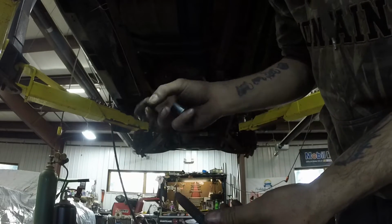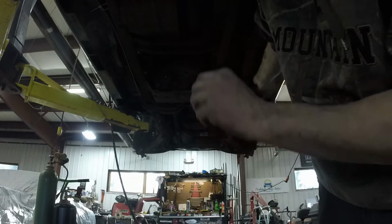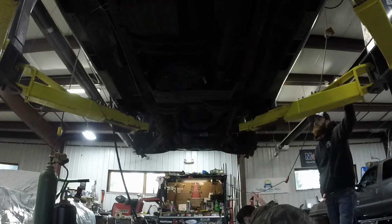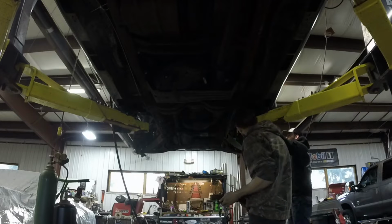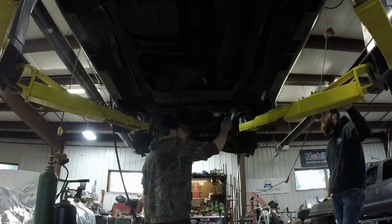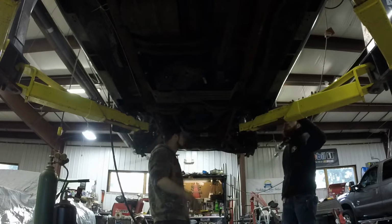So there it is. After you get this out, this is what sits in there. The bolt goes through this, and this end is what pushes the torsion key up, which twists the torsion bar, and that's what actually gives you more ride height. Science. That's the control arm. Is that how you turn your keys? Yeah. That's what I was just explaining to the people watching this video on YouTube: instead of a coil spring, these bars are actually your springs. I call them torsion keys because that bar is literally twisted, and that's what gives you suspension.